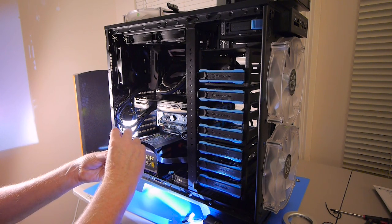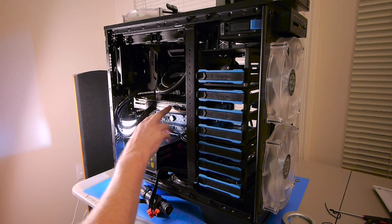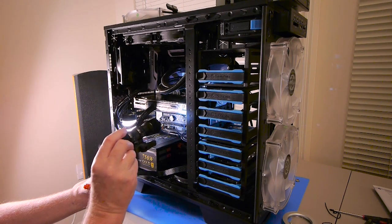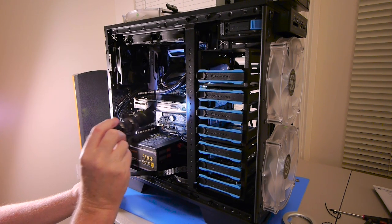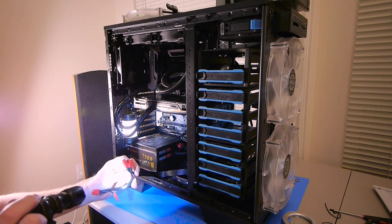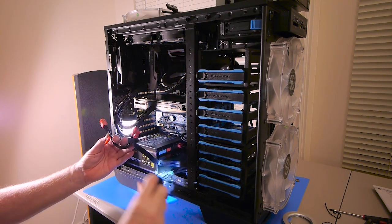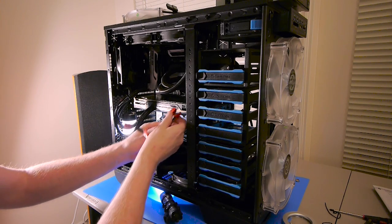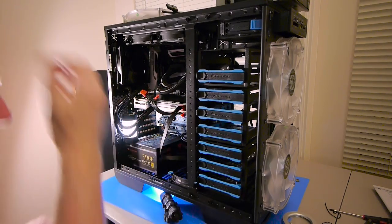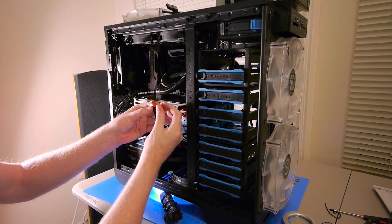And then it's a, let's see, that's a 3 and a 3. One moment. Figured out the PCIe power connections to the graphics board. They didn't make it easy. Okay, so there's a 6-pin and an 8-pin header on the graphics card. The cable has 2 6-pin connectors and 2 2-pin connectors. So the 1 6-pin plugs in to the 6-pin as you would make sense. Keys on the bottom, ears on the bottom, so it plugs in like so.